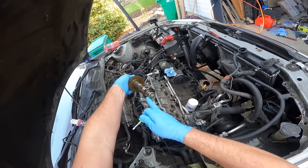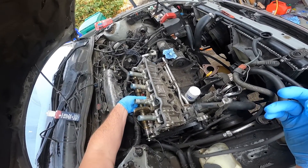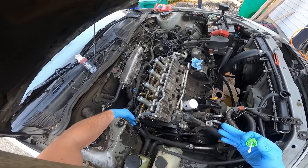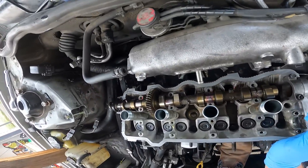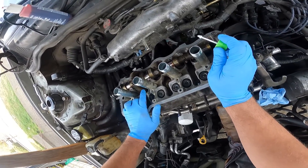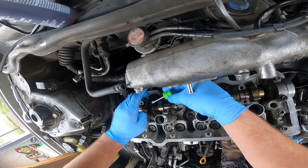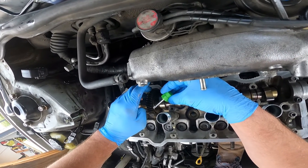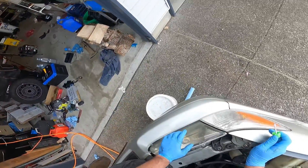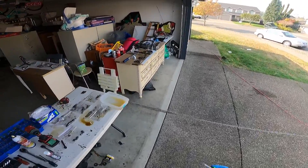When we set this in here, we'll set it with this little pin facing about the nine o'clock position relative to the engine — facing pretty much parallel, just a little bit above parallel with the engine. With that set in the engine, you can see one timing mark here, one timing mark here, and one timing mark there. That bottom timing mark and that one — we're not going to pay attention to those. All we care about is the middle timing mark. Put a little bit of whiteout on that tooth, because I don't have a paint pen.